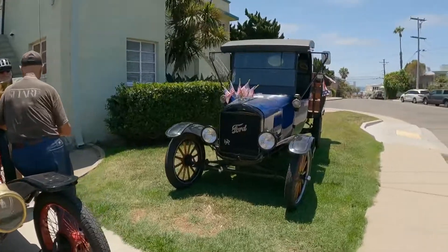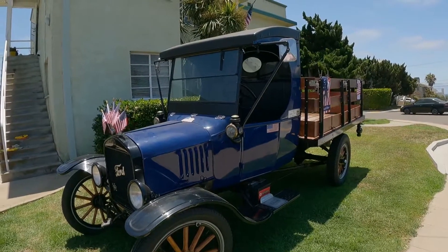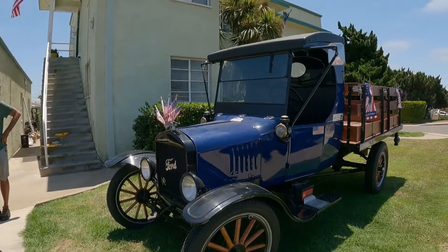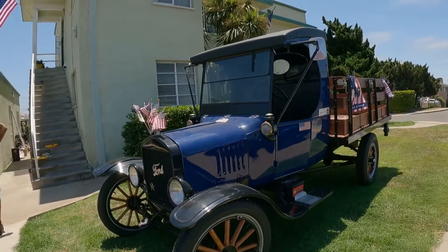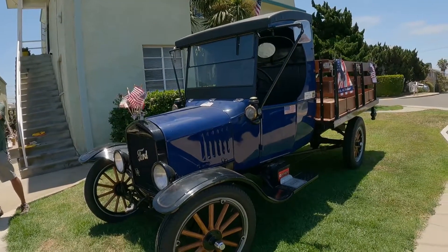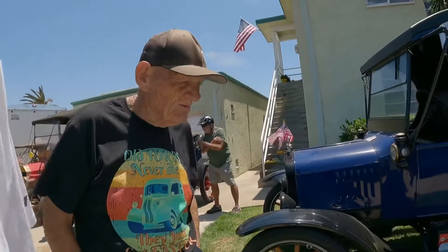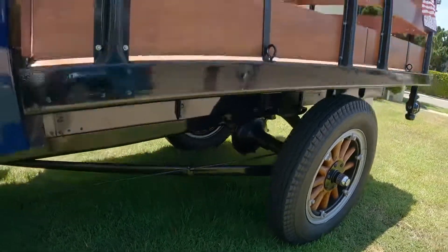What about this '22? You've got a work truck here. Yeah, it's just a '22 TT. TT? Ford, up until the mid-30s, if it was a truck, he doubled the letter. So you had a TT — you didn't have a Model T truck. You had an AA — you didn't have a Model A truck. It was just a work truck. It's a heavier frame and differential. It's got a worm drive driveshaft in the back where the other has a pinion drive. That's the main difference.